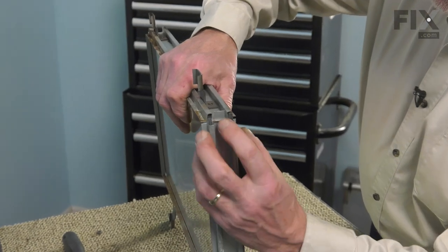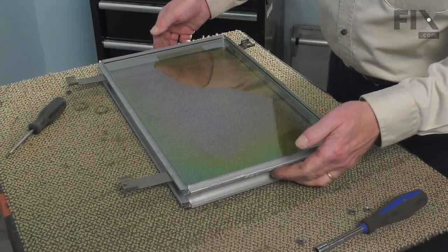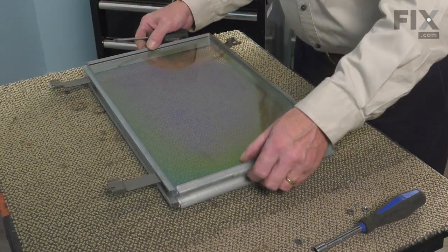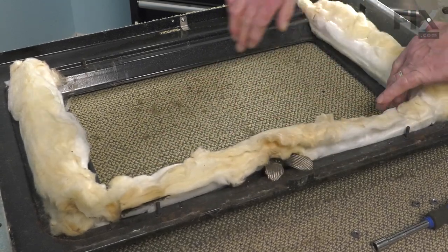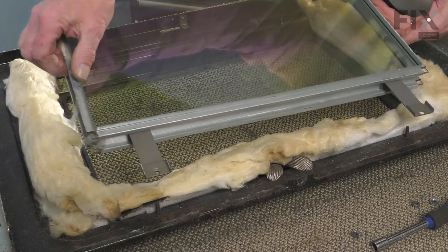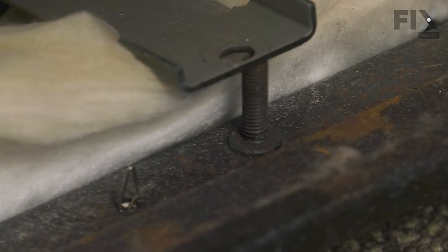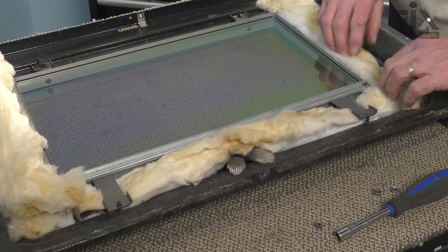Make sure that tab is fully inserted and fold it over to lock it. Once we have both surfaces of that window pack clean, we're ready to put it back into the inner door panel assembly. When reassembling this door, we want to make sure that we pull that insulation back away from the opening on that inner door panel and then tuck it back into place once the window frame is laid in. The long legs go towards the bottom of the door and sit over those two studs. Take note as we're placing it in there that we don't catch any of that insulation in the opening, and then carefully tuck it down into place.